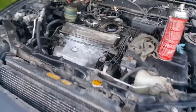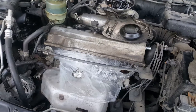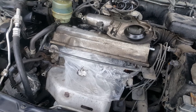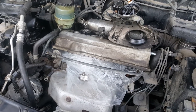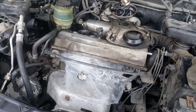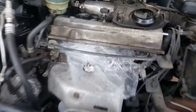I'm going to take the crank seal out of a 1998 Toyota RAV4. I did the timing belt — it was broken when I got the car and it's contaminated with oil, so the seals are leaking. I'm going to do all the seals, and I got to the crank seal and wanted to figure out a way to get it out.